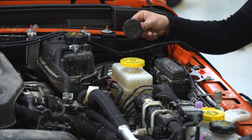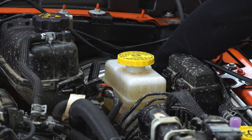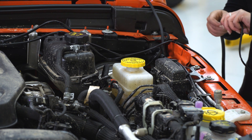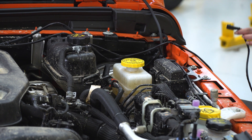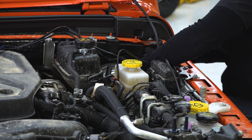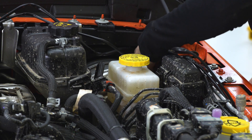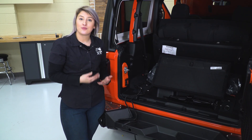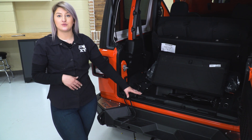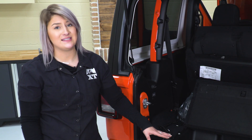Just as a visual, this is what it's gonna look like. What you can do is disconnect your actual leads to your lights from your wiring harness. You can put the light leads aside so you're not putting a bunch of wires through this — you can just connect it on the other side, it's gonna make it a little bit easier. After you've run all of your wires into your cab area through your firewall, we can come back to the tailgate here.